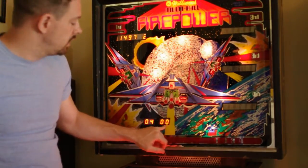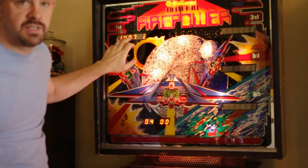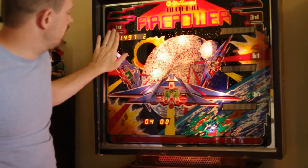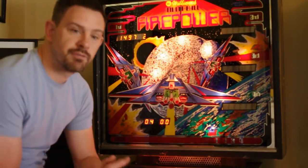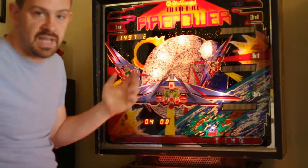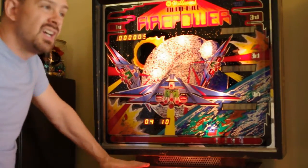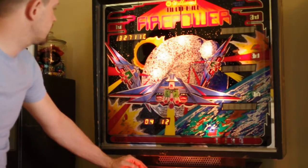00 is the audit number. Up here, the '1497-2' tells you what game it is and what software revision it is. The number 1 means you have a green set of flipper ROMs — a 0 there would be the yellow flipper ROMs, which is more System 4. 497 is the game number that Williams assigned to Firepower, and the 2 means it's the second revision of the Firepower software. So this actually does mean something if you know how to read it. If you press your advance button it'll start cycling through. The first dozen or so are record keeping — it tells you how many games are played, extra balls, and all that should be spelled out in the manual for the game itself.